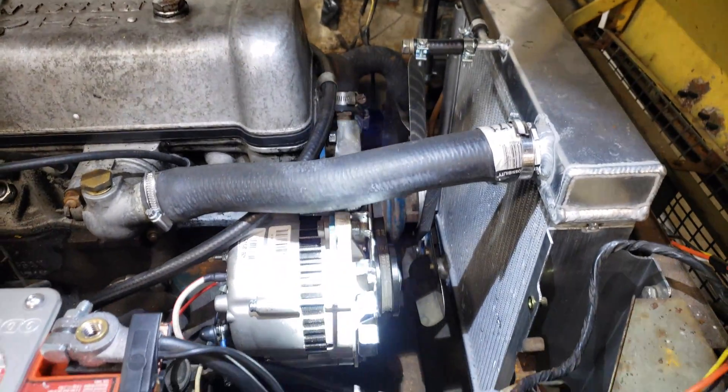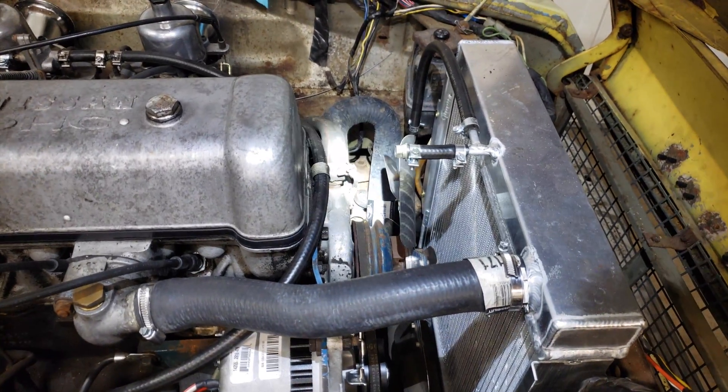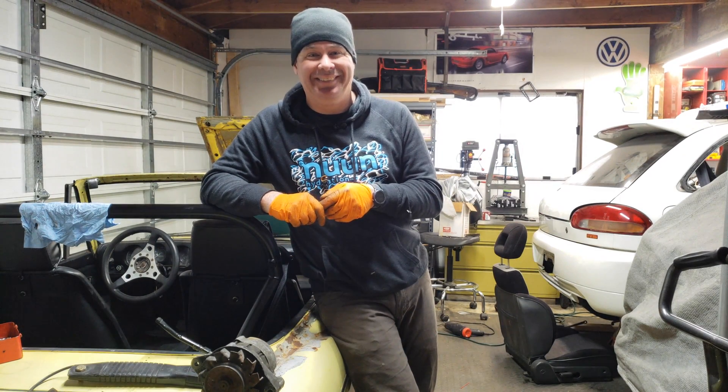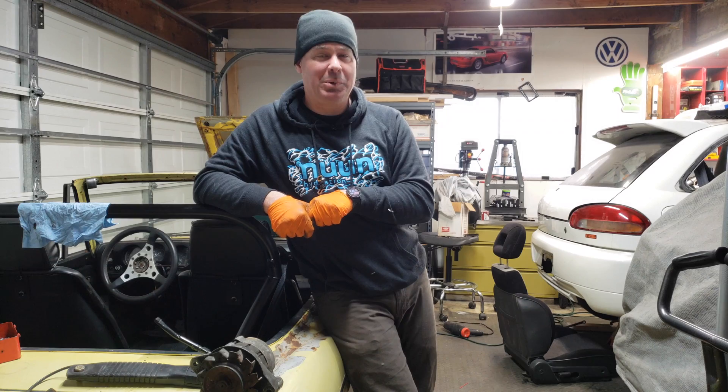You can see it bolts up just like the factory one did, lines up with the original factory upper alternator mount, and the pulley is dead on to the second notch on the fan pulley, so it lines up and tracks just like it should. When running I've gotten 13.8 volts at the battery with no accessories on, so I'm real happy with that. That is all there is to putting the B210 alternator in the Datsun - save yourself some money and make your charging system a little less complex. I'll put the link to the Z car store adapter below - supporting vendors that support these cars is important.